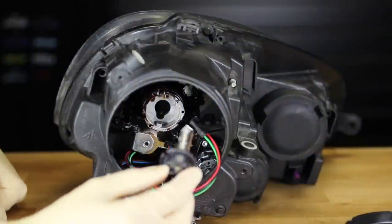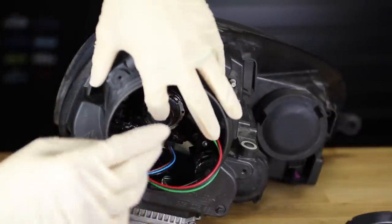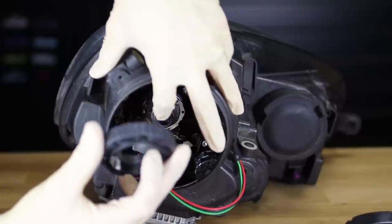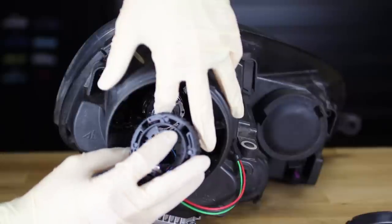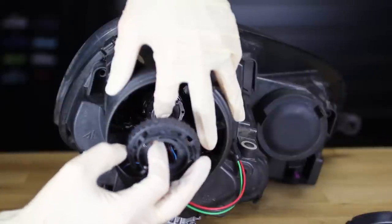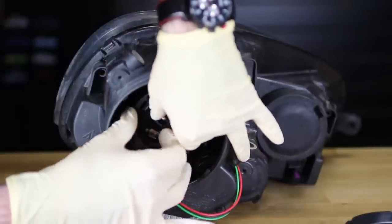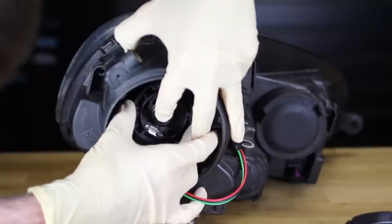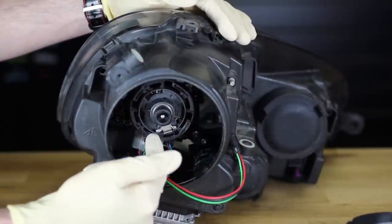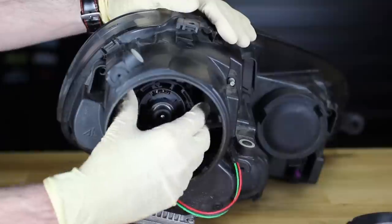As we go to reinstall our bulb, we just slide it in there and make sure it's in the correct place. It's often easier to put the bulb in already just for ease of installation. This cap here has writing on it that says 'top.' If this cap is not in the correct orientation, it won't seat in place and you're going to struggle. So we slide that on, and here we have our orientation where the bulb is seated properly and the locking cap is also seated properly. All we're going to do is turn it about a quarter turn clockwise — and you see it locks in place very easily.